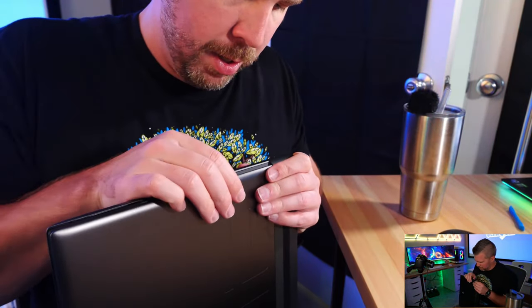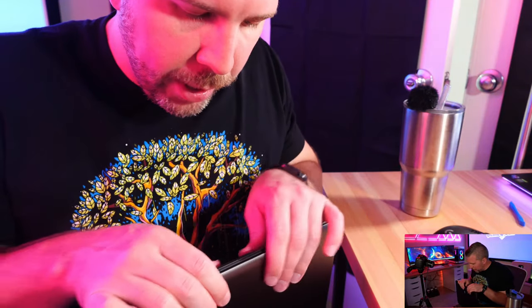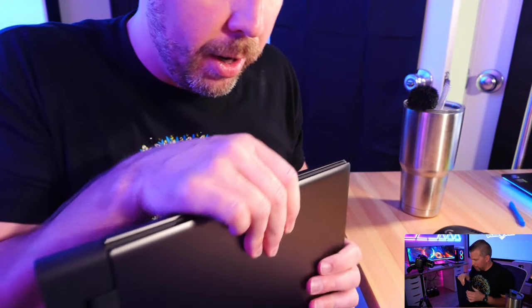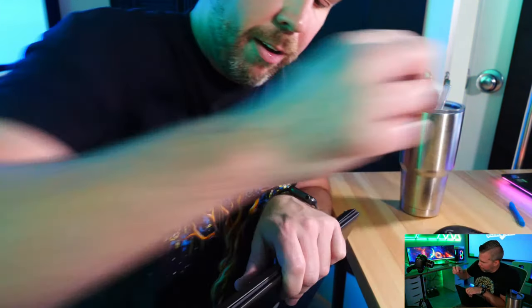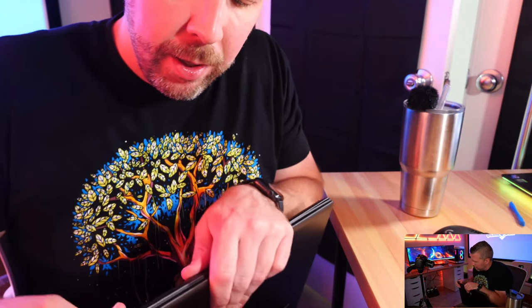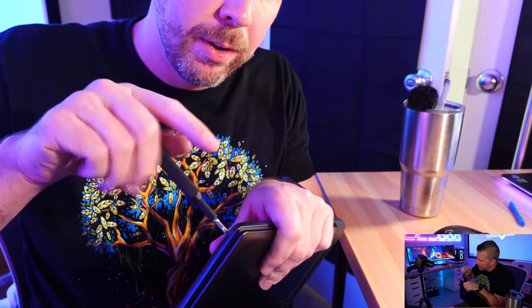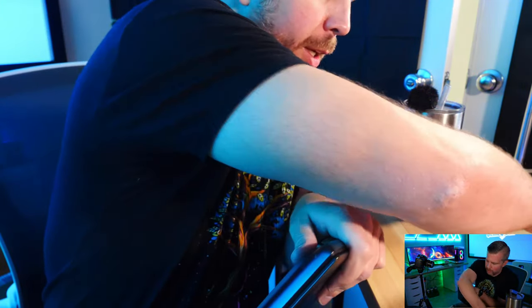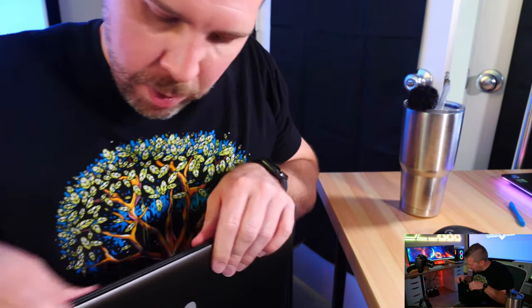Okay, so time to pop this guy back together again, which is a lot easier if I hold the laptop in my lap. So in general, I try to get the initial pops just getting started, and then I'll do the pop-up screws. These pop-up screws are going to fight you as you're trying to pop it back together. And if you just screw them in right away at the beginning, that'll get the chassis actually started to being popped in anyway. So get those pop-up screws in. Now you get it. All of that's popped in.